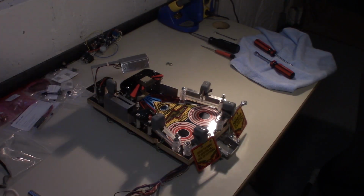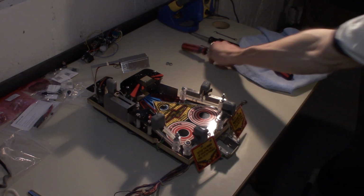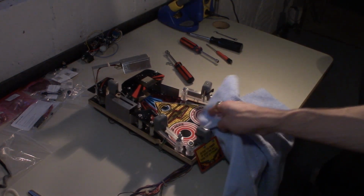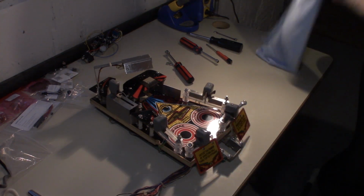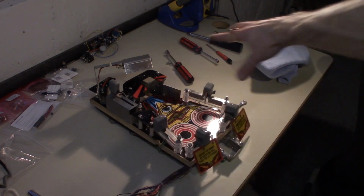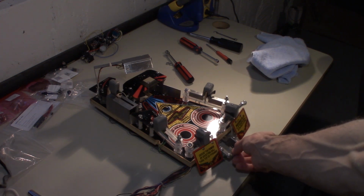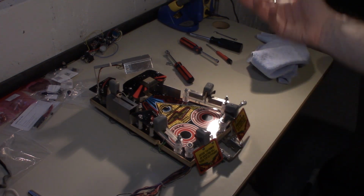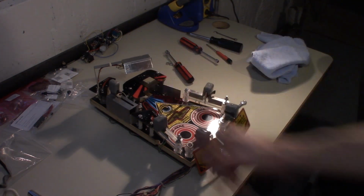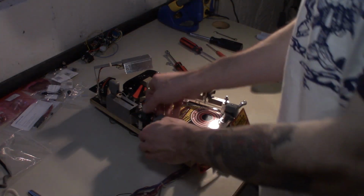All right, so we got the entire mini playfield completely cleaned with Novus. Then we went ahead and we waxed it with our wax, let it sit for 20 minutes. Once it hazed over, we just came in here with a microfiber, wiped everything down. Then we put brand new star posts, new rubbers, cleaned all the plastics. Everything is back on it, except for the opto here, where the ball exits. It has to be done from the underside. I replaced the bulbs in here with LEDs, along with the one on the side there. So that's all been replaced. Everything on the top side of this has been replaced.